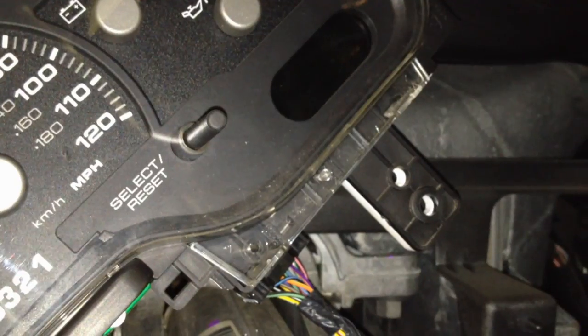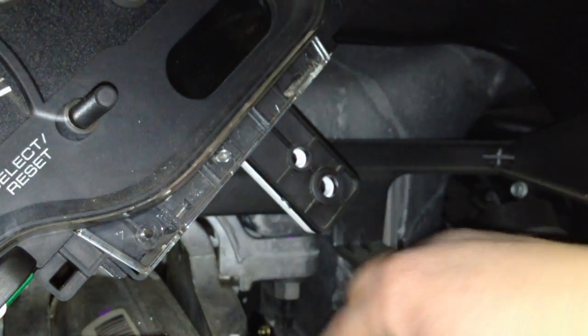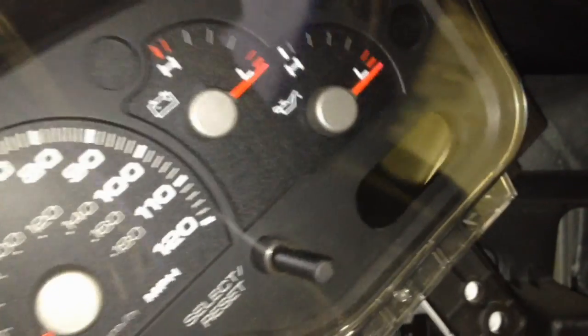At this point we can pull the cluster. Turn the ignition off, then pull this seven millimeter screw — same thing on the other side. Lay it to the side, then there's a little retainer tab right here: undo that and your connector will come out. There's one connector on this side too — disconnect that and get it out of the way. After that, just angle it out of here. On the back side, all the white bulbs — as opposed to the gray ones — are your illumination bulbs. You can see they're all over the place on this one.